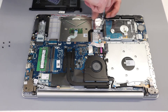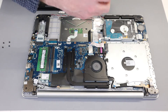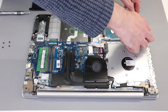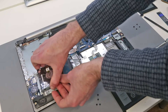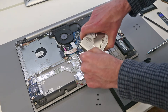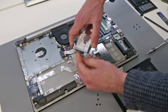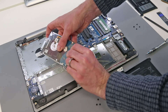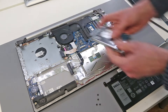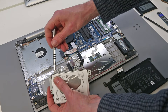These four screws hold the drive assembly in place, so we are just going to lift up the drive and flip it over. With that done we can use this central piece — it does just seem to unclip that back bit of plastic — so we can try our best; it's quite a stiff fit on this one, but just unplug the SATA connector. Now with that done we have four screws on the drive which we need to remove.